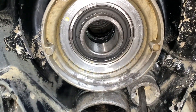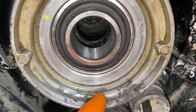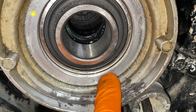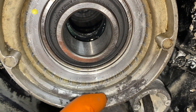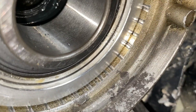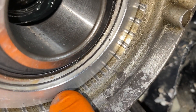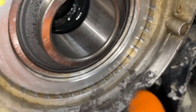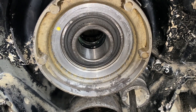Now to a closeup of the inner housing and bearing. As you can see, it's a little sweaty because it was frozen. This inner bore must have one eighth inch available or showing after you install this gimbal bearing flush with the back stopping point. Not this housing, not the next step up, but the third step up where those grooves are. One eighth inch must be accessible — if you do not have one eighth inch accessible, you are not flush with the back stopping point and your gimbal bearing must continue to be driven in until it meets that back stopping point.